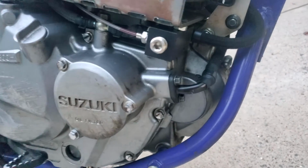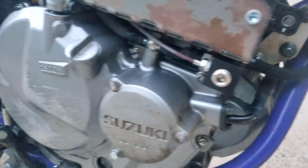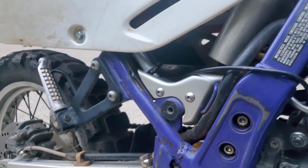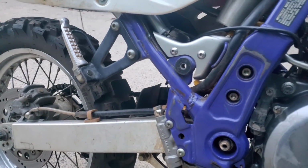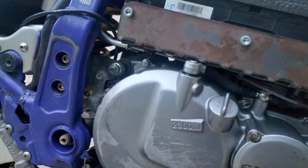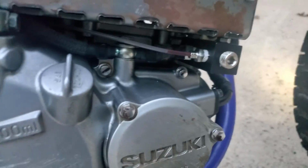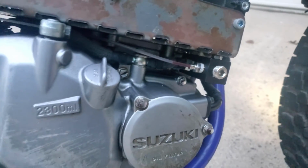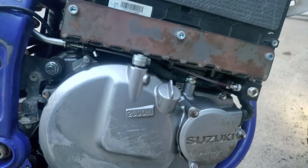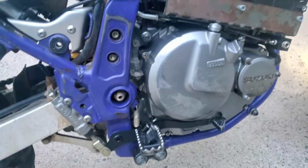So you can see a little bit about how it works here. I replumbed the stock oil system, so these oil lines go back to an oil cooler that's up in the back of the bike. Probably add a fan to it. It's picking up a lot of heat, so I'll put a fan on that later. And anyway, the oil circulates back through the oil cooler, back to the front, into this manifold block where it's distributed out to things like the pressure gauge, to the transmission, and then in the future a couple more oil sprayers that I'm going to install around the motor.